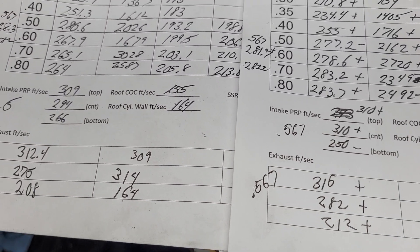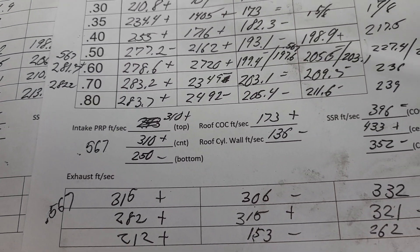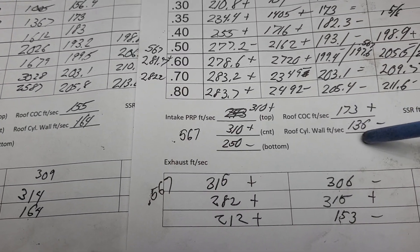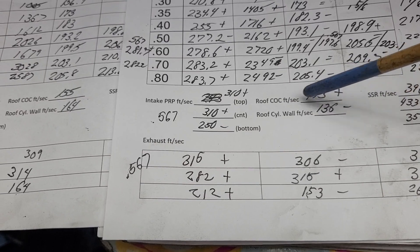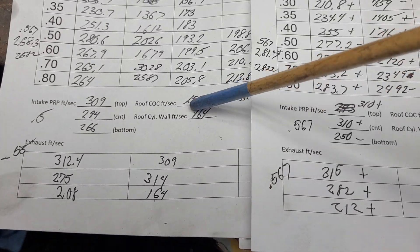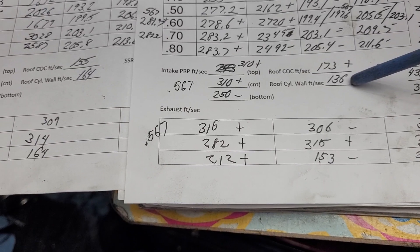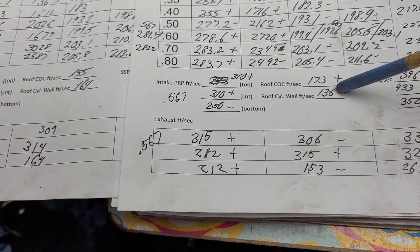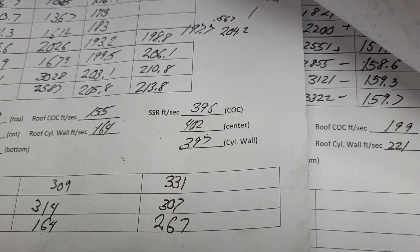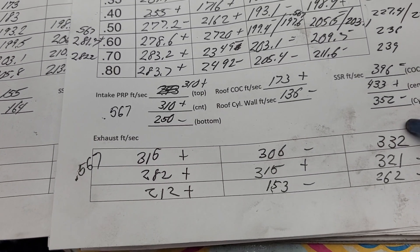How did we do on the roof? According to the air speeds, I gave it more area in one spot, and the speed went up considerably in the center of the cylinder but went down at the outside. So not a complete win — they're almost 40 apart, which is way worse than what it was. The valve job might be part of that as well. I haven't touched the chamber, but the short side radius got some work. As far as short side radius speeds, it went up very fast in the center and lost a little bit on the cylinder wall side.